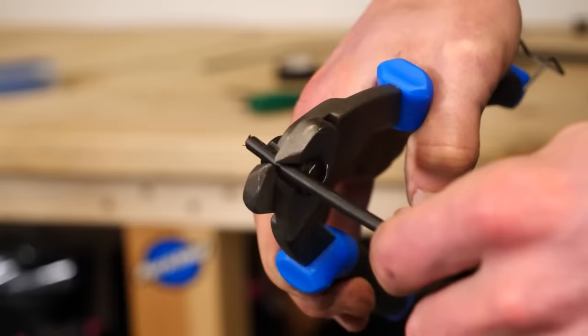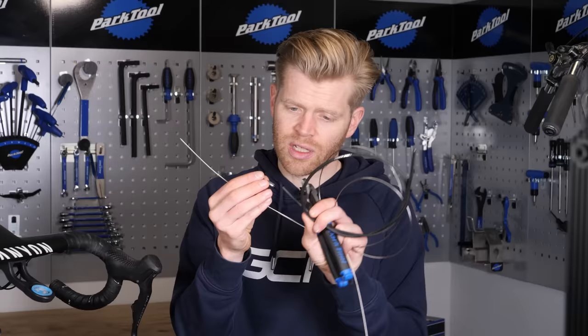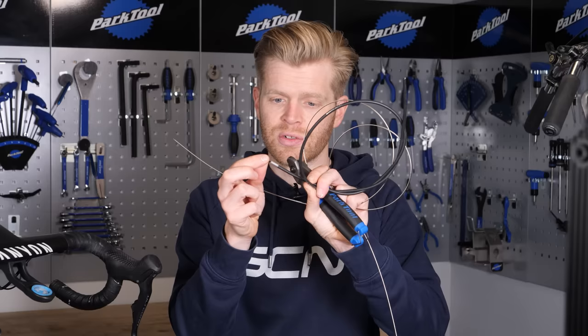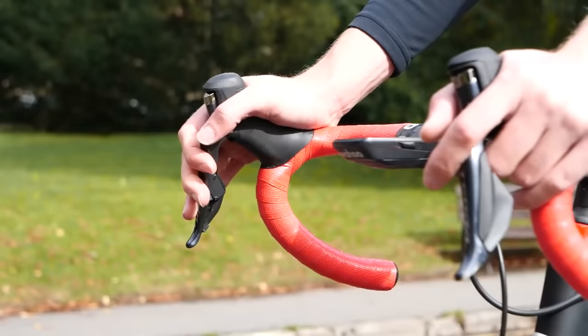When you're fitting your brake outers, make sure you cut them to the correct length and make sure that when you fit ferrules onto them, they are flush right up against the end of the cable and there's not a gap — they're not loose. If they're loose and they can move, then when you pull the brake lever, what will happen is you will close that gap and pull the ferrule onto the end of the cable, and that's reducing the amount of braking performance that you have.